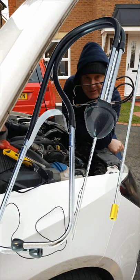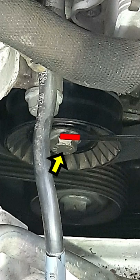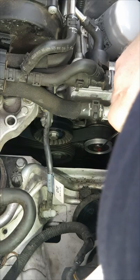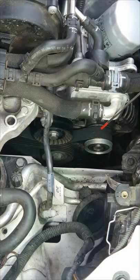And if you've still got the noise, it's probably a bearing. So you need one of these — a mechanic's stethoscope. Put the probe on the bolt that holds each bearing and pulley in. If you can't do it on the bearing, do it on the casing. You can tell when a bearing's running smooth and you'll hear which one's screeching. You'll know what to replace.